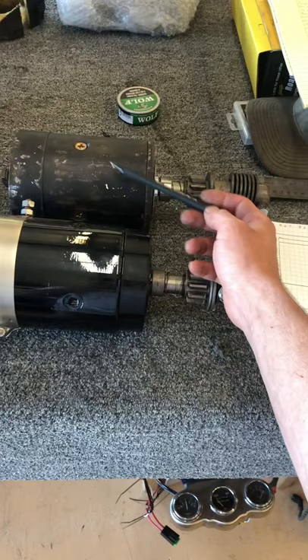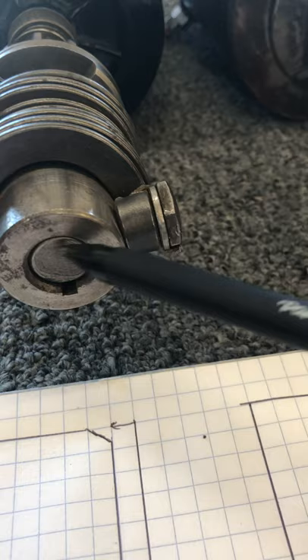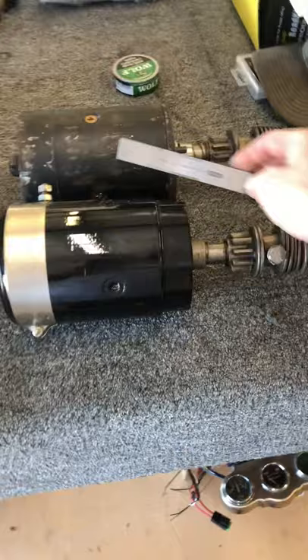I've got here a Power Master starter that's been patina'd — this was a brand new starter — and a factory Ford starter. I've got some interference issues with the Power Master starter. You can see where it has ground on the back side of the bell housing. I've put this factory Ford starter in the motor and started it, but the starter struggles when starting because it was rubbing, and it's also getting pretty hot.